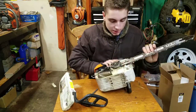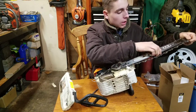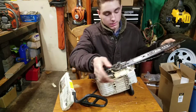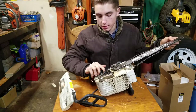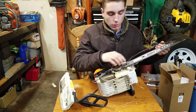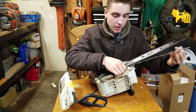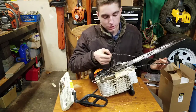The saw has a cold-weather shutter. If you're in a climate that gets below 32 degrees — like I am here in Michigan — you can just flip this switch. I just flipped it to summer, and I'll flip it back to cold weather. It takes some adjustment away from the carb and lets it run better so you won't have to re-adjust your carb.